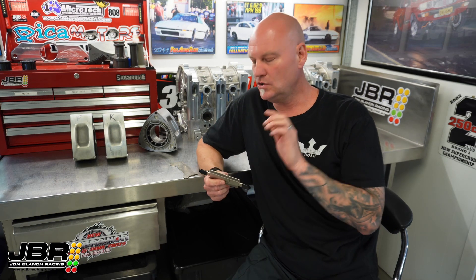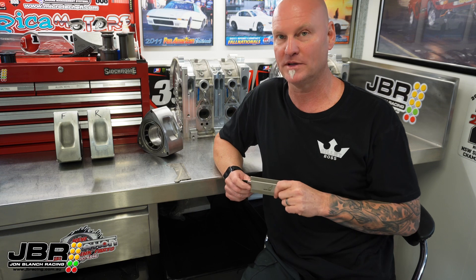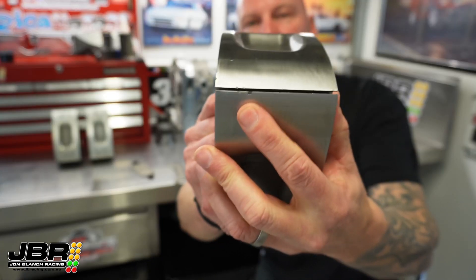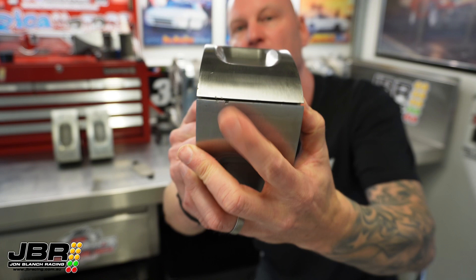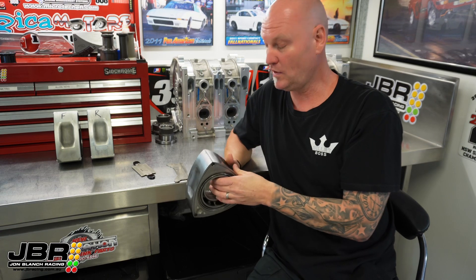When I'm building an engine I'll use the file at a couple of different stages when assembling the rotors. The first stage is when I pull the rotors out of the parts washer — everything's clean and I sit them on the bench. I'll run this through the grooves to make sure there aren't any dings or damage, and no carbon I've missed when cleaning. It's quite common for rotors to get dinged and damaged, and usually it's the tips of the rotor or the apex grooves that cop it first. If you have any rotors with marks in the grooves, you can run the file through and it will square the groove back up, taking out all the dings so the apex seal can move up and down freely.